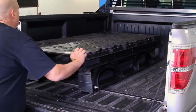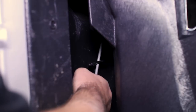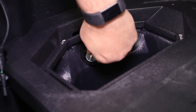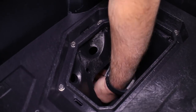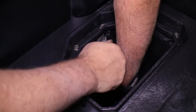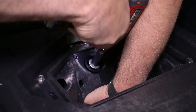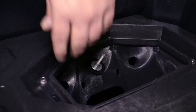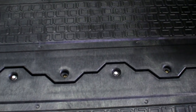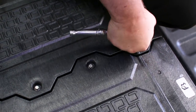Once the axles are finished, slide the deck into place on the driver's side. Insert the J-hook through the center hole on the driver's side ammo can and loosely attach it to the tie-down bracket with a spherical washer, flat washer, and a nut. Now the passenger deck can be lifted onto the bed and set into the center vert to line up with its corresponding bolt locations. Bolt it in and install the J-hook tie-downs in the same fashion as on the driver's side.